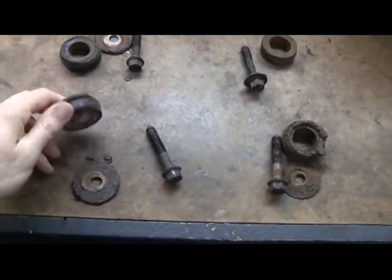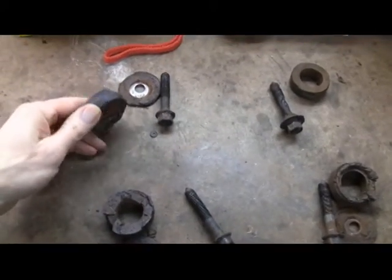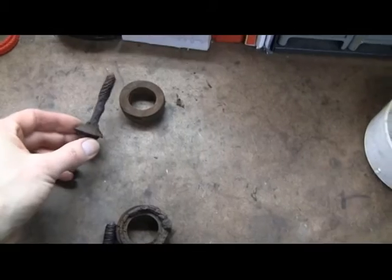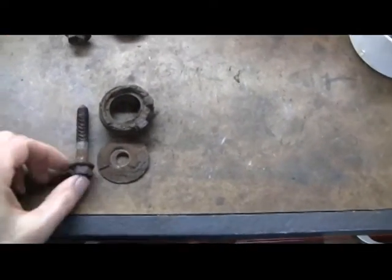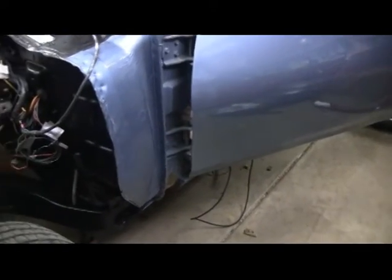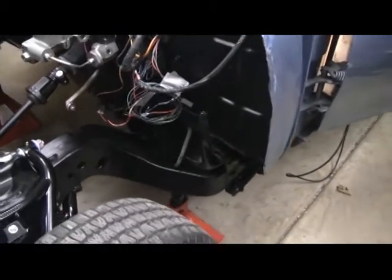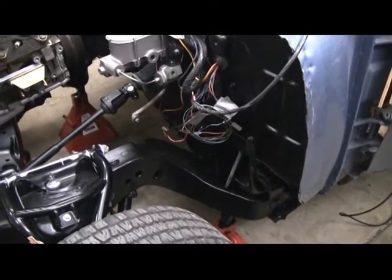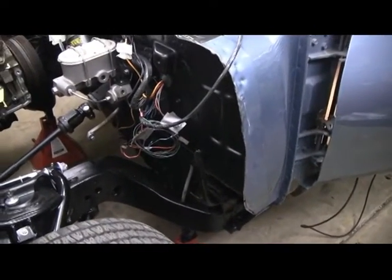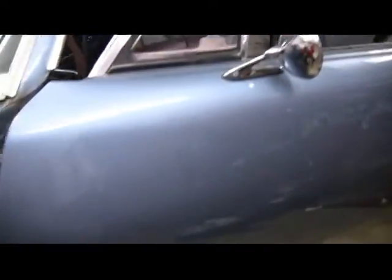These don't look too bad on the back — they're definitely dry rotted and definitely need to be changed. But look at this one here: the bolt is almost rusted through, there was no washer at all holding this thing on — nothing. This one here, the bolt's a little bit better, but these mounts are just totally shot. There's not much left holding the body onto the frame. The only body mounts that are left are the two in the front, one on each side — they're loose. I'll leave those on there until we actually go to take the body up off the frame. The other two things remaining are the parking brake cable and the gas line that goes from the body where it mounts to the hard line that goes to the frame.